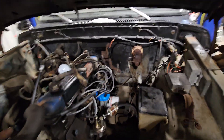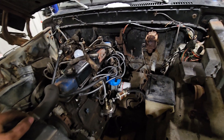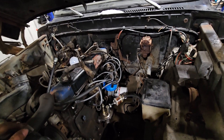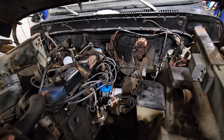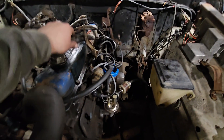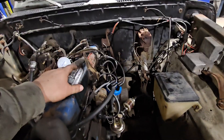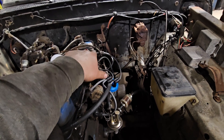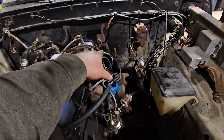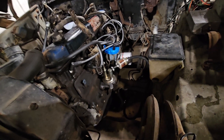The 300 inline-six in it right now does run, but it is very hurt. I've got at least one cylinder that's completely down on compression, and this thing has a lot of blow-by — just from driving it in the shop, oil is just blowing out of the valve cover. And once I got it running and drove it down the road when I first got it to the house, it was blowing oil all over the firewall. So this engine is hurt.